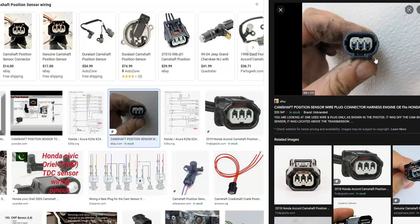You want to get the schematic for your engine year before you start. With the common three-wire setup, the middle one will be ground, one of the outer ones will be going back to the battery as a reference voltage — it'll always be on at like 12 volts or 8 volts. The third wire goes back to the onboard computer.